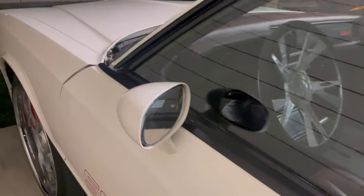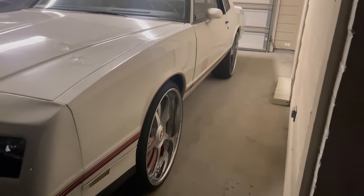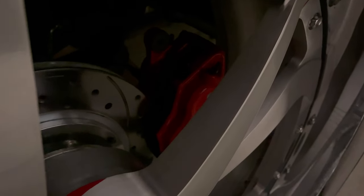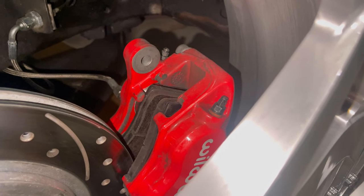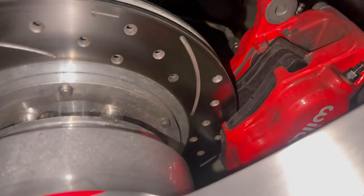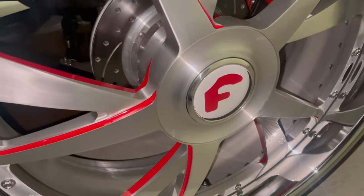But guess what? When I made it here and hit the brakes, the car barely wanted to stop. I got out, checked the fluid, and all the fluid was full. Something said go around the car, check all the brakes, just look. The caliper is hanging off the rotor. I don't know if y'all can see. Let me adjust this and hit the light on for y'all. Yes, the bolt backed out. The brake pads are just hanging on the caliper and it is off of the rotor. So I'm wondering why, when I hit the brakes coming in the garage, it was damn near gonna keep going.